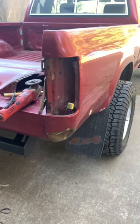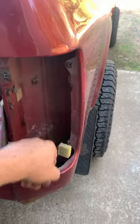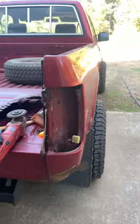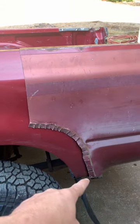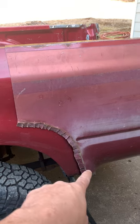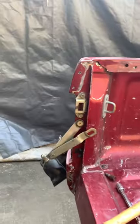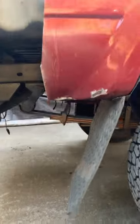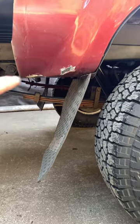So I've got them stripped down. Instead of drilling out these tacks, what I'm going to try to do is grind — just come in with the grinder and grind the heads off, so I'm not left with big gaping holes I have to completely weld up. Never tried it that way, but I'm going to. What's a big deal is down at the bottom — I need all the new metal I can get because I do have some rust down in here. Same on this side. There's pinholes and I might have to fill that out with other metal.